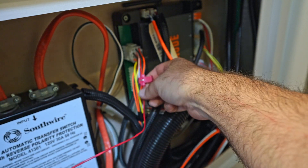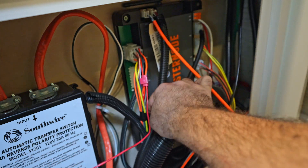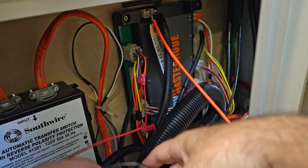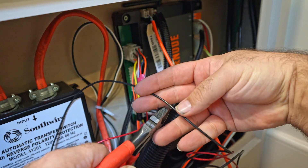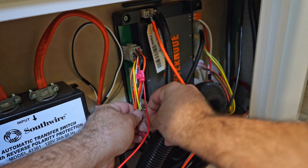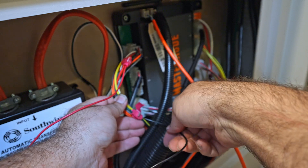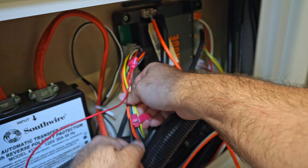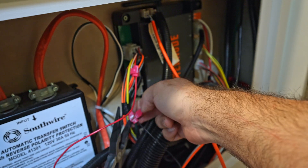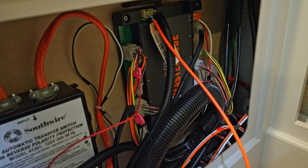The red wire has been tapped into for start, clipped over, and now we need to do the same for the green wire which is our stop signal. I'll come down a little further and stagger this out, then do the green wire tap for stop using the black wire from the box. I've used these taps several times and they work great. So our start and stop are done. Now I mentioned the orange wire — I'll show you what that's about in a second after we test the system.